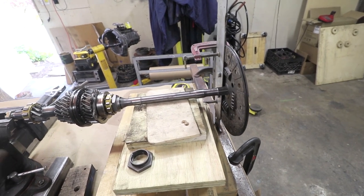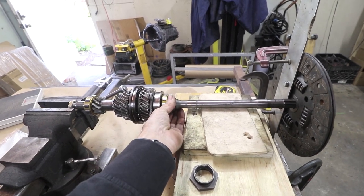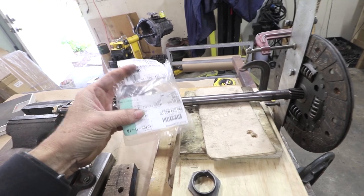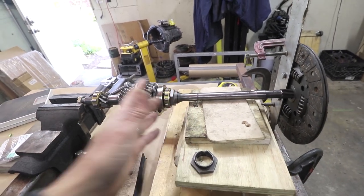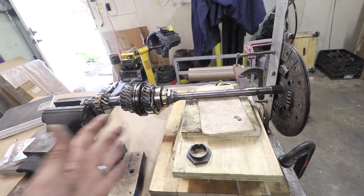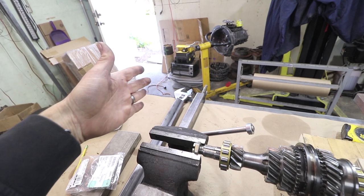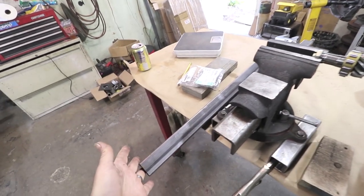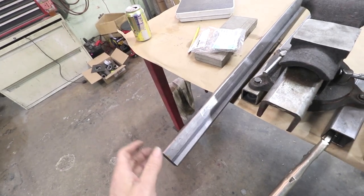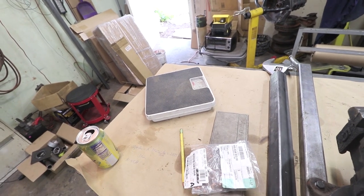This contraption is what I use to take the old nut off — this is the old one right here. I'm getting ready to torque the new nut on — that's going to be a critical torque value for the whole input shaft, and it's 130 foot-pounds. This is a brand new nut right from the Porsche package. I don't have an open-ended torque wrench, so I'm going to use a long adjustable wrench on a bar which I measured at 34 inches. I did a little math and know that I need to apply 45 pounds to the end of this bar to equal 130 foot-pounds. I'm going to use my bathroom scale to estimate the amount of torque.